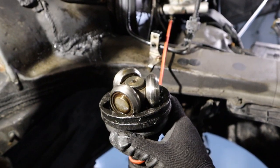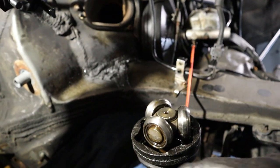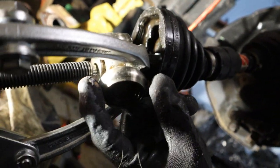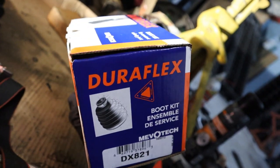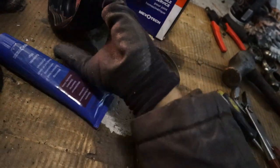While I am here I am also going to be replacing the CV boot along with the clamp, because that was leaking and is why we have grease slung all over the driver side. Once the circlip is removed I can remove the tripod using a puller to pull it off the spline shaft. The boot number I am using is from MevoTech — the kit includes two new clamps, a tube of grease, and the boot itself. These clamps require special CV boot crimping pliers. I am going to load the grease up after I have got the transmission in, just so it doesn't make a mess.